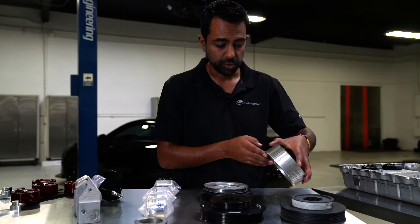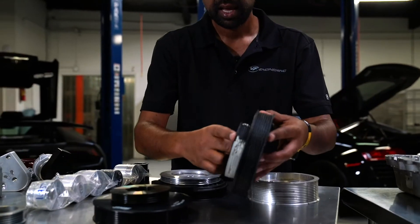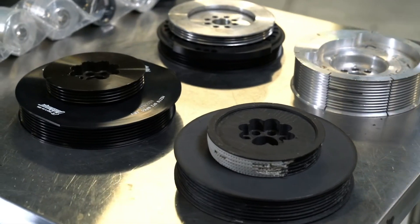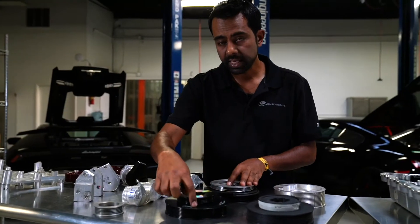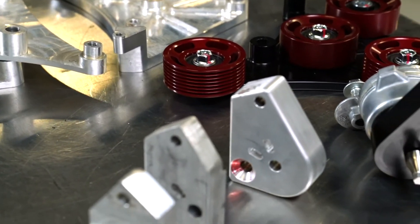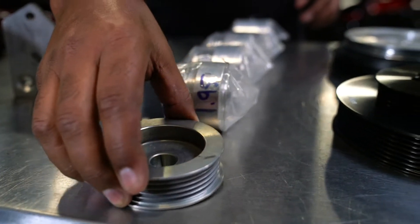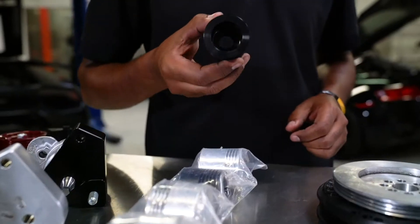We also tested a wider version. The ultimate design was then created and printed in plastic again, and the pieces were then converted into a production version. It contains an eccentrically weighted free-floating weight inside it, and what that does is counteract the harmonics created by the engine's crank as it rotates up to 8,700 RPM. The crank pulley drive system will also drive the alternator. You can see the factory alternator pulley and the different versions of pulleys we created as tests for different concepts, ending up with the final version.